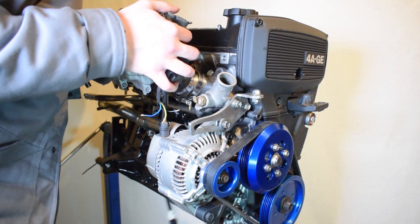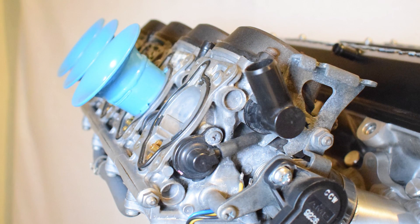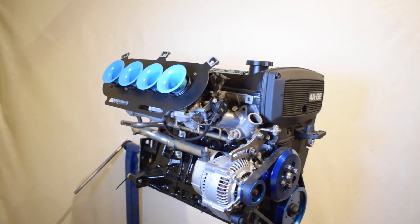I'm super happy to have this in my car because I've done extensive modifications to my 4AG — I removed fuel injection and installed a set of bike carbs, which is definitely going to mess up your air fuel ratios. If you've done any modifications to your engine that can affect your air fuel ratios, I definitely recommend getting a wideband gauge. I also recommend the X-Series specifically because when it comes to price, no other gauge responds as quickly, and it won't let you miss any changes in your air fuel ratio when they happen.